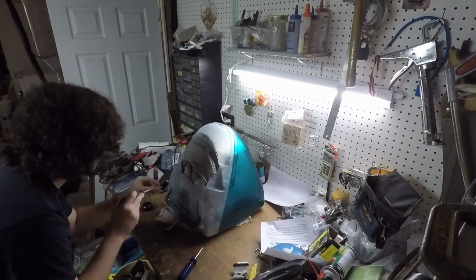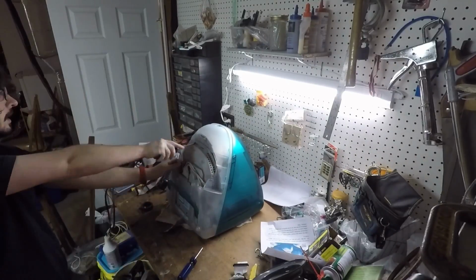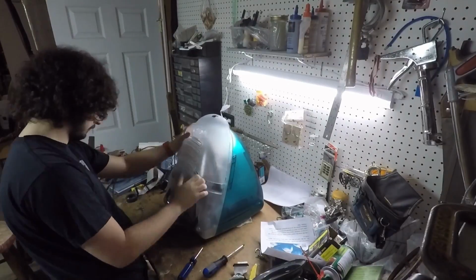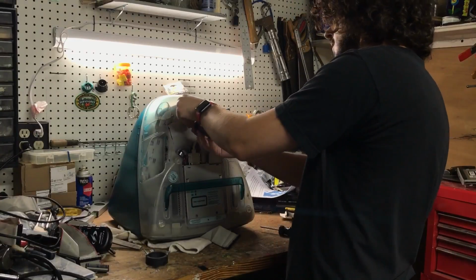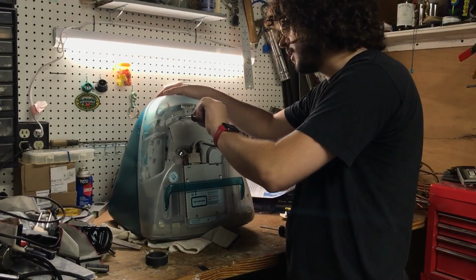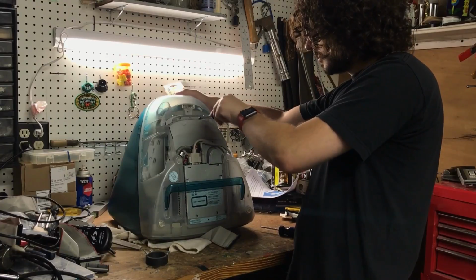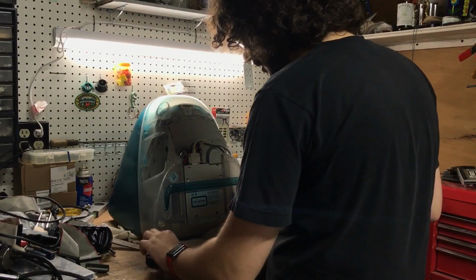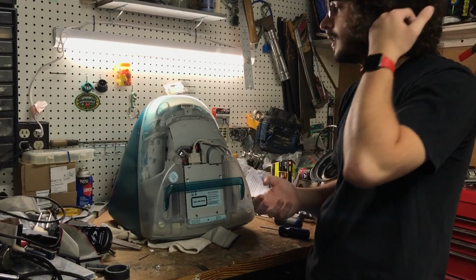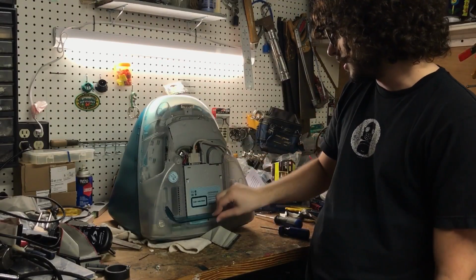So my thought process behind the 100% reassembly is the chance that maybe there's a safety or a ground wire or a ground connection using the screws, that maybe this machine has something like that. I wouldn't think that a machine from 1998 would have some sort of safety configuration like that, but this is Steve Jobs era Apple, meaning that they would go to fairly extreme lengths to keep the user from making contact with anything that could be potentially dangerous, including things like the power supply, or in a machine like this, the very, very highly electrified CRT tubes. So I wouldn't put it beyond them, but I'm going to just reassemble the whole thing and see if that makes a difference.